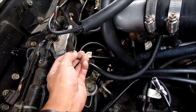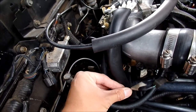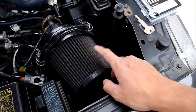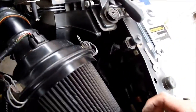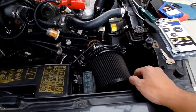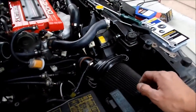I found out that these wires here are all not in good shape. This one is about ready to go — it looks like a basic spade connector, so probably use that. Just trying not to break it. I would like to get the car running. I think I should have cleaned this before I put it back on, but it's too late now. I put the bracket on there and just used the grommet as a washer. I was drilling the hole and I'm like, man, this is going to be a huge hole, so I decided not to — I just use it as a grommet. It's got some play in the front and the back. So that'll work. I did that one and then that one, and then I'm going to do the intake right now.